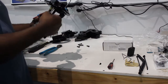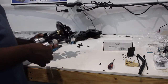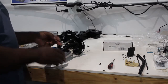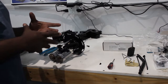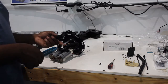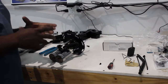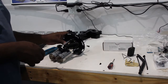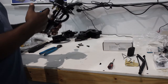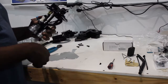That one's looped underneath — comes up, comes down, goes back up to the barb connection. You attach your hose clamps. The pumps seem to slide on a little bit easier with the larger brass hose barbs. What I do is start off the whole process — go boil some water, put it in a coffee cup, and you can drop these hoses down into the cup for two or three minutes. They'll soften up a little bit and it allows you to slide them onto the hose barbs easier. Once you loop both hoses to each hose barb, you clamp them down and that's it — you're ready to go.